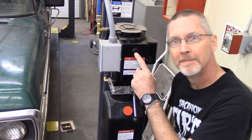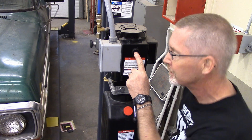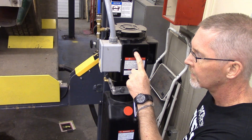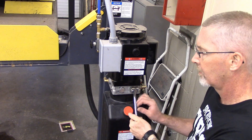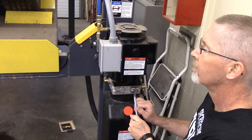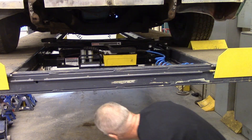When you're raising the hoist, this is your magic power button to go up. Don't mind how shaky the whole hoist looks — it's a little sketchy. Can you hear the locks? Once you clear all the locks, push this to lower the hoist onto the locks. We never want to leave anything hydraulic or cable hanging and suspended. Make sure it sits level — you could be not quite on all four locks and it'll sit really crooked.